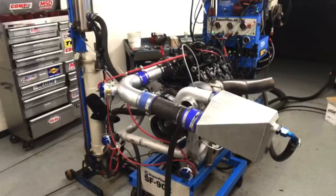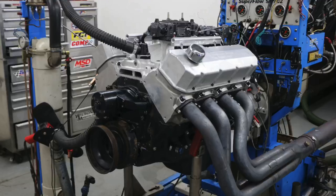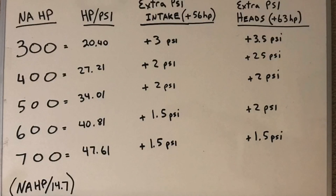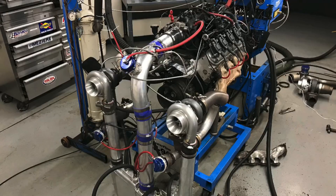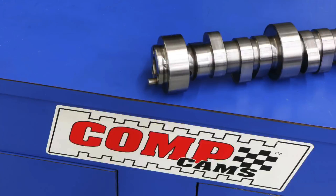So what did we learn from this adventure down the rabbit hole of boost versus modifications? First, you don't really need to make those modifications on most combinations — especially ported heads and intake upgrades. On the LS combination, just do cam and springs and boost; you won't need head upgrades. Now if you're going for all-out maximum power with 2,000 horsepower worth of turbo, then yes — ported heads, cam, and intake will definitely help, because naturally aspirated gains multiply under boost. But as we saw on our little 4.8, if you're just turning up the boost, you can reach the turbo's maximum output with just cam and springs. Make sure to like, share, subscribe, and ring the bell — I'll keep testing.